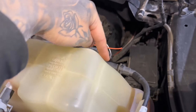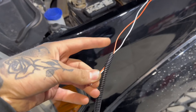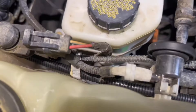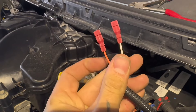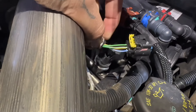Pull enough wire through so you can run it along the coolant reservoir and over to the sensor. Grab the loom that comes with the kit and feed it on all the way until it hits the firewall. Run it up underneath and along the coolant tank and over to the plug. Pop the yellow tab up and unplug the connector. Strip the ends of the wires and put the little red splice connectors on — thread the wire in and give it a tug so it's nice and tight. Pull back the loom a little to expose the green wires: there's a green wire and a green and white wire — those are what we're splicing into.